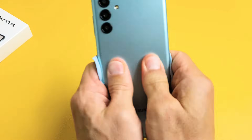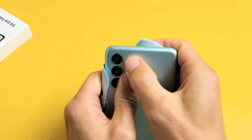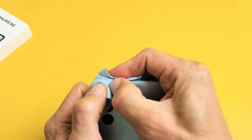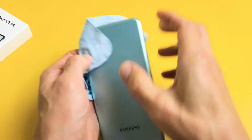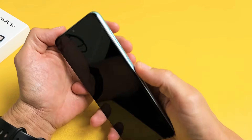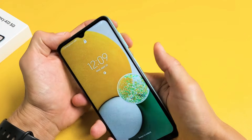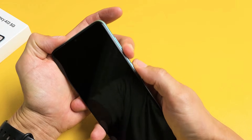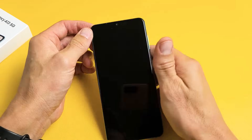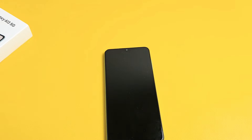Do the same pressing on the back side — give it a good, nice massage all over. Press all around the lens area too. If you hear a little click, just wait a bit and see if your phone boots up normally. After that, volume down, power button, press and hold both buttons — do not let go until you see the Samsung logo appear, then quickly let go. Hopefully now you are up and running. If not, we'll go to the next fix.